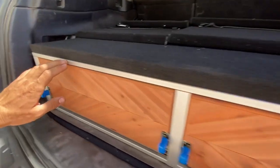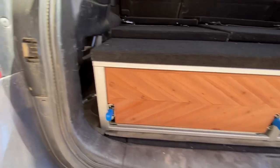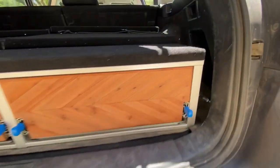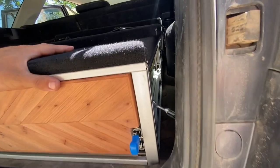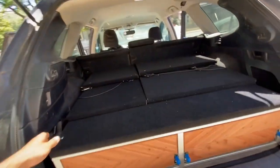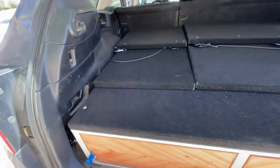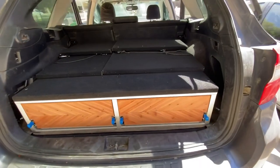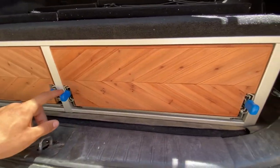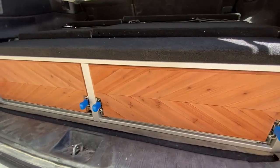I made it a little more space-efficient, used half-inch up here to get deeper drawers. It's completely framed with aluminum extrusion so it's super solid. It's hooked into the car on all four points — one over there, one up there, and here with these turnbuckles — so it's basically part of the car when you get it all hooked in.